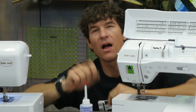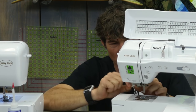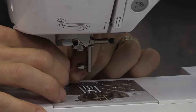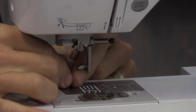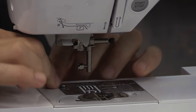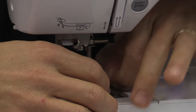A lot of our machines nowadays have these beveled screws that hold our stitch plates down, and it's really hard to get even wonderful little screwdrivers up inside to work. So ten cents will fix that problem almost every time — sometimes you have to invest 25 cents. You can drop a coin in those screws and use a coin to loosen them right up. These are special beveled screws and you do not want to lose them because you won't be able to replace them at the hardware store. Take it nice and slow, and once we get this stitch plate off we're going to dust and clean inside, keeping track of those screws.